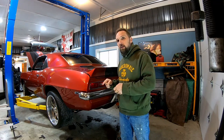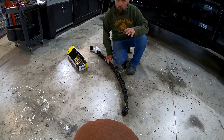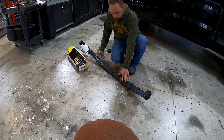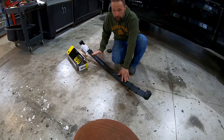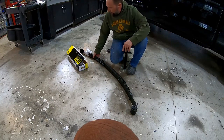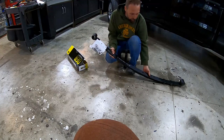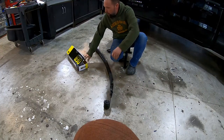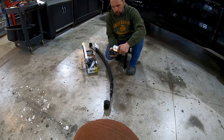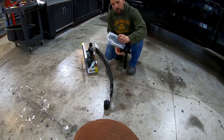I found two problems in the back. Here's our solution: I picked up a set of Summit brand two-inch drop springs, the SUM-7081-GM2. It turns out these fit a whole bunch of cars, not just old Camaros. This is a nice multi-leaf spring that comes from Summit with the rear bushing hole empty, so if you're going to install these you want to make sure you have a bushing kit. I went straight to OER through Summit and ordered a complete rebuild kit — this comes with the shackles, the bushings, and new U-bolts.